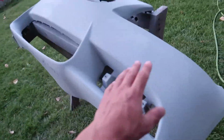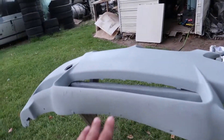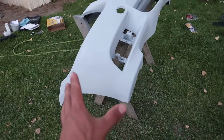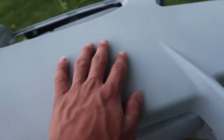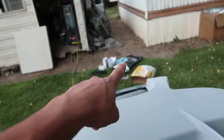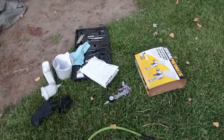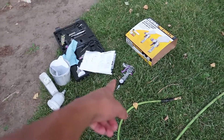The bumper's all painted. I went over it a couple times because some spots didn't pick it up very well — so it's got about three coats of primer. I don't see many imperfections, just a little dark spot there. Everything else looks really even. I'm not sure if it's my gun but you can see wrinkles in the primer, which is really weird. It's filler primer so maybe it was too thick. I can sand them out later, but it's hard to clean the gun. I have to head up to Tristan's — he's going to help me clean the gun. Last time I cleaned it wasn't very good, so hopefully he can show me a good trick.